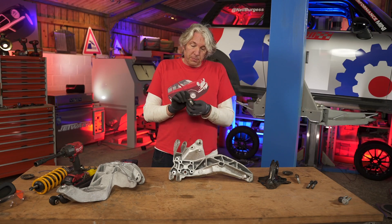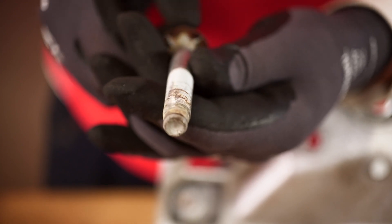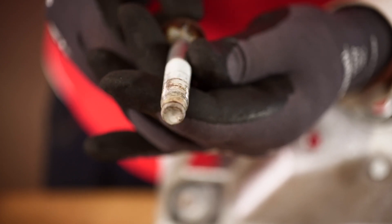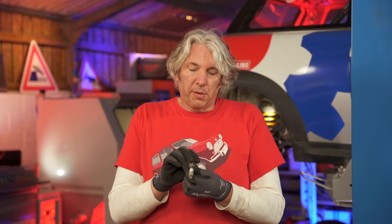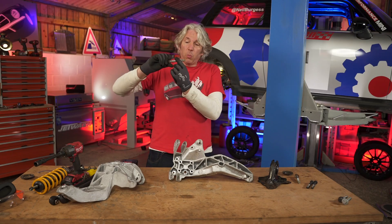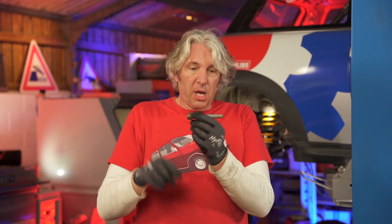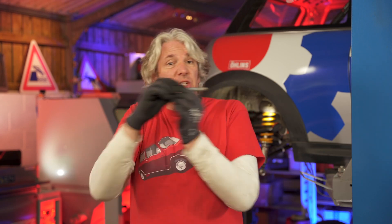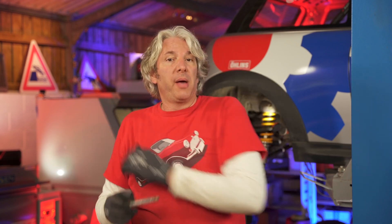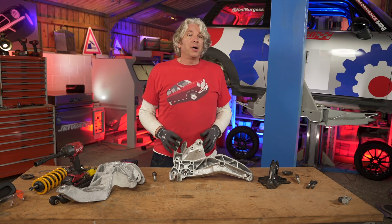What's quite interesting about these bolts is they actually have kind of three lobes on them. If I spin this round, you can see there's a stripe that goes through. Basically, what's going on there is that those little lobes kind of help crush the aluminium into a different position to try and actually make the joint a bit stronger. But of course, when you undo all that, you undo some of that work. So when we went to tighten everything back up again, as we're winding the bolt in, the threads of the aluminium in the casting, having been weakened, just literally sheared off as the bolt was tightened in. Rather than tightening the bolt up, it just pulled the aluminium out, leaving us with no thread in our casting.